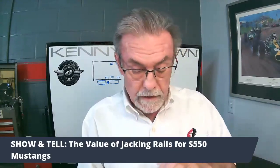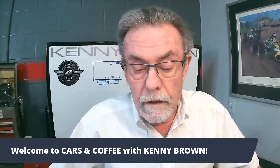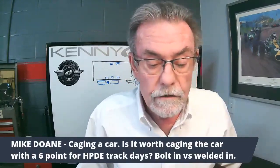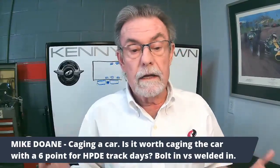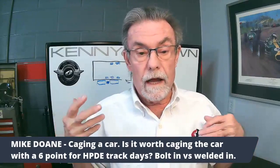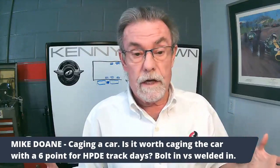Let's take a look at some questions. Mike Doan is wondering about caging a car. Is it worth caging a car with a 6-point for HPDE track days, bolt in versus weld in? Obviously, weld in is better, but you can't take the cage out if you decide to trade in the car or sell. Anytime you can add any additional strength into a car, it's a good thing. For HPDE, it's a safety measure, and it also adds rigidity to the chassis. And you just can't add too much rigidity to the chassis.